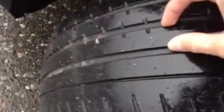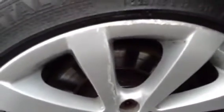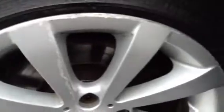Looking at the nearside of the vehicle, one or two very light dinks but no real dents. No chips at all on the rear door edge or the front door edge, and some light scratches to the bodywork — just cosmetic marks really. Underneath the doors there are a couple of light scratches. Mirror looks fine. Front quarter looks fine on the nearside, and the front tyre is around 4-5mm. The nearside front alloy definitely needs a refurb — it's got a lot of kerbing and scuff marks.